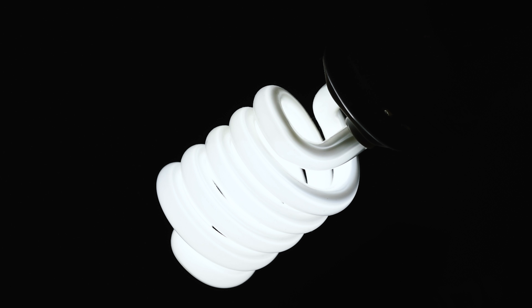Bringing in an extra light really helped so you can see down in there — try to get it up and above so no shadows cast across your sensor. That gave me confidence to get in there and clean it. With the pen, I started in the top left corner of the sensor, dabbed, then touched the sticky paper, then went back, eyeballed the area I already covered, moved over a little bit, dabbed again, touched a new spot on the sticky paper, and repeated that process — always using a new spot on the paper. I went through about three of them in one cleaning. I cleaned the whole thing once, went outside, took a photo, still saw a little dust in one or two spots, brought it back in, cleaned it again, and now it's spotless!